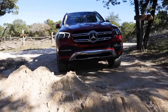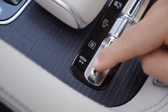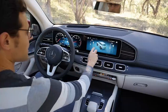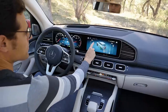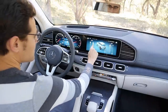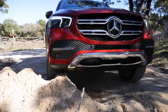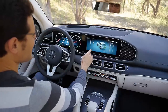One of the driving modes is also off-road — then the car is pumped higher and you can use those special functions. When you use the suspension button, you get to the free driving assistant or to the individual wheel control. This is very interesting because you can put the car up on the right and all the way down on the left. Switching it around, you can also tilt to the other side. If you lose traction on one wheel and want to put it down or up to face the next obstacle, well, it's possible.